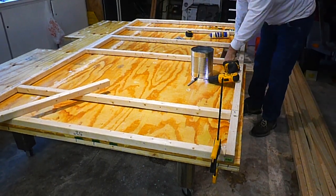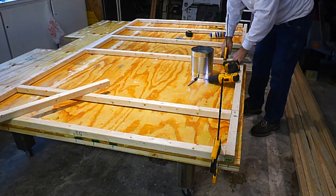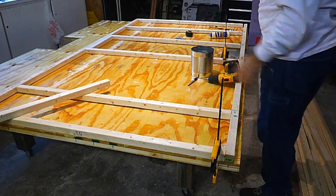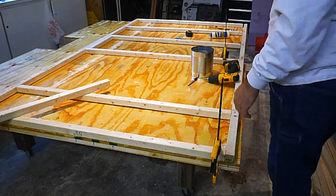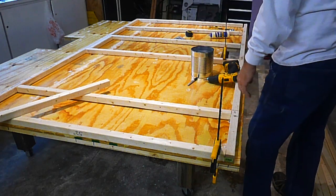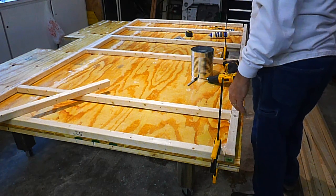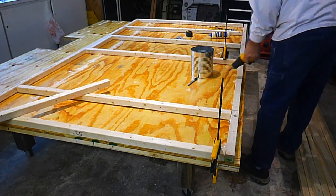I'm going to put the roof on, so I don't want anything sticking up. The floor looks a little rough — actually that's the underside of it. I've already put one application of fiberglass resin on there and it's soaked in really well. You can see the spots were soaking in nicely. I'll put one more coat on there, then lightly sand it to get the blush off and put a top coat on to make it look uniform, then flip it over and bolt this trailer.